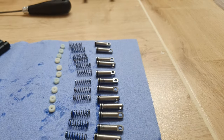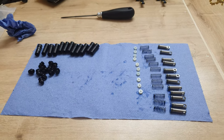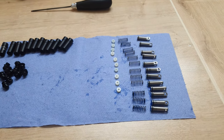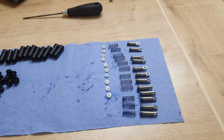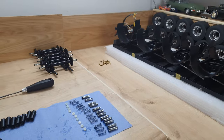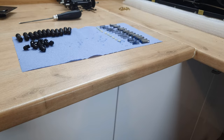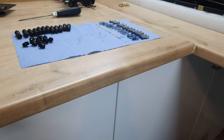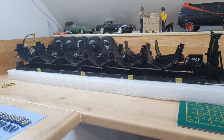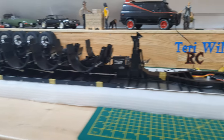What I'm going to do is make sure all of these are the same, so I've got balance across the six axles both left and right. I'll get all the axles back in and then finish wiring. I'm going to reassemble those and leave the axles off until I've finished the wiring, because it is a heavy trailer.